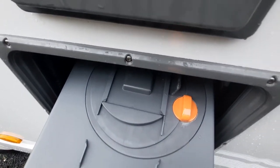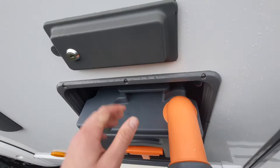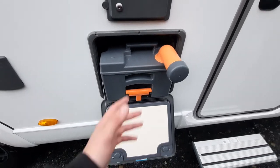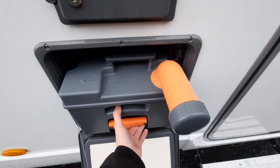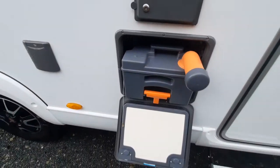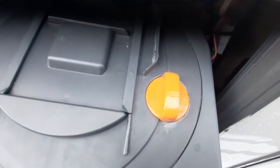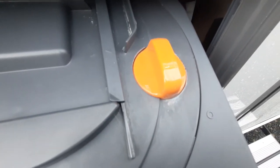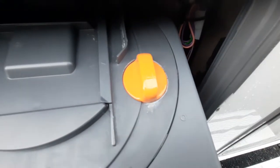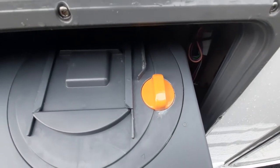Your other button makes contact with the blade. The main thing is that when removing the cassette you must always make sure the blade on the toilet is closed. If the blade is open you'll try to remove the cassette and it will get caught and jammed. In the past, people have simply pulled it, breaking the cassette — that orange button is what allows the blade to open and close, and forcing it can rip off the entire system. So make sure the blade is always closed when removing the cassette.